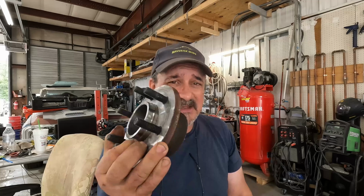So basically, if you get any water in these things, it just starts washing the grease out. I don't know for certain if the factory hubs were that way or if this is the aftermarket hub deal, but whoever in the hierarchy of whatever company that makes these things decided that saving 5 cents on a shielded bearing versus a sealed bearing, I want to talk to them. So new hubs are on. No more grinding noise. Life is good on the pickup.